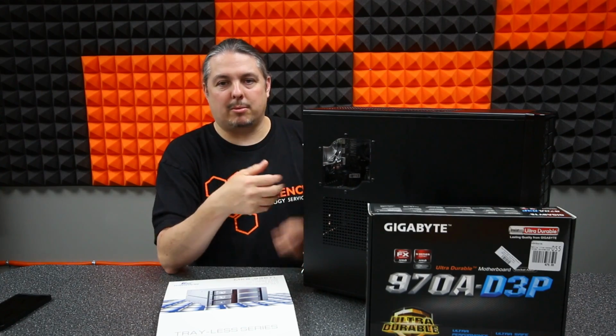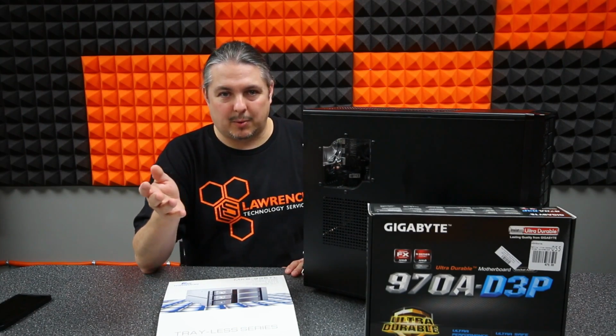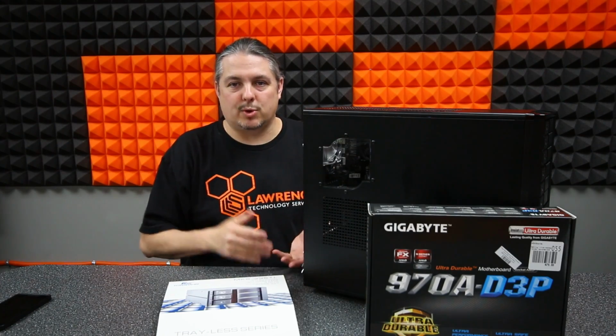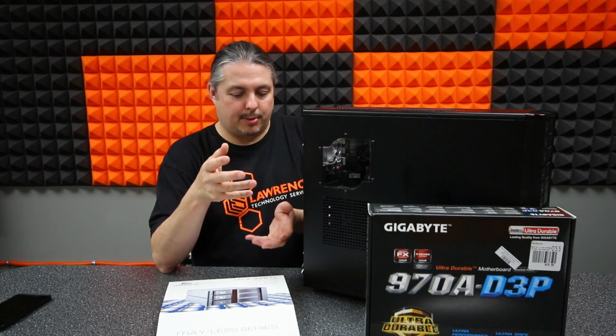So if we ever had a problem, we could just replace the board. It doesn't care. It's not particular about hardware like Windows is. You can take the drives out. As long as you have all the drives, or at least enough of them, you can rebuild the pool in another FreeNAS machine, and it'll bring them all back in.